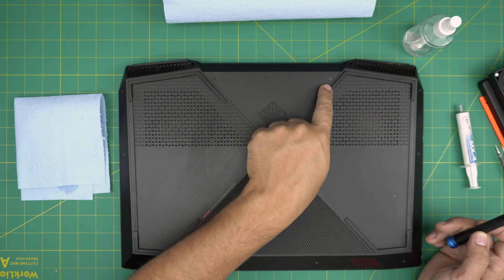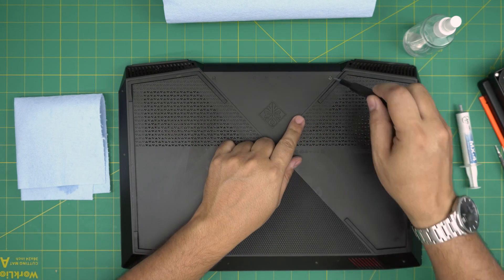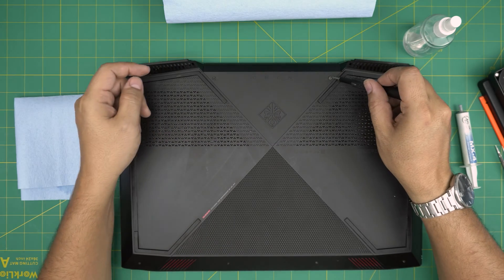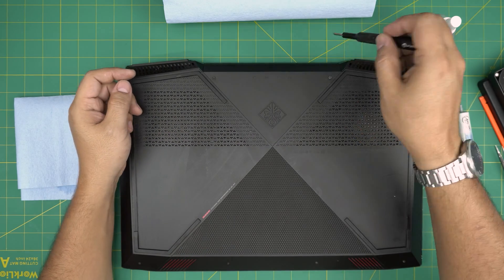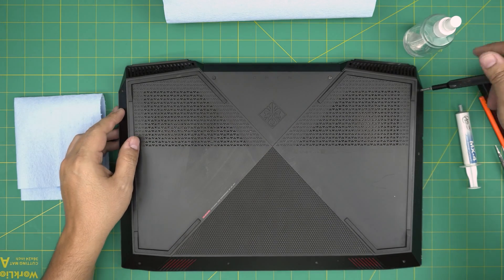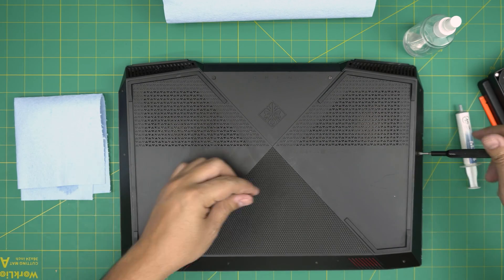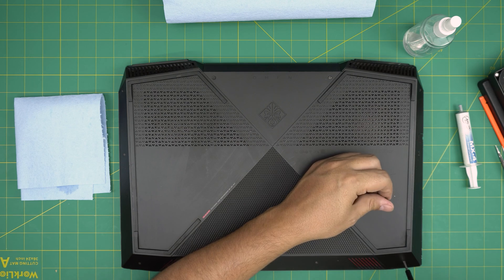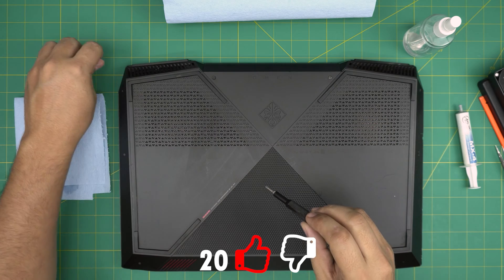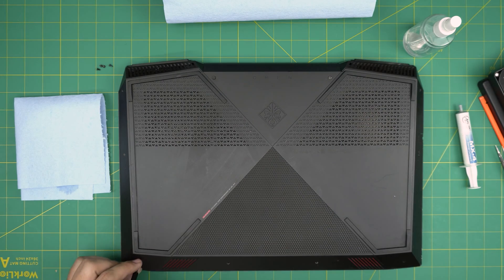On the bottom cover, remove all the screws except the two screws at the mid-back. Those have a C-lock on the other side — you can rotate and twist them but they will not come out. Just loosen those two screws at the back. The rest of the screws are the same size and height all around the casing, so go ahead and remove all of them and keep them in one pile. Also, if you find my videos helpful, please click like and subscribe — it helps motivate me to make more videos.